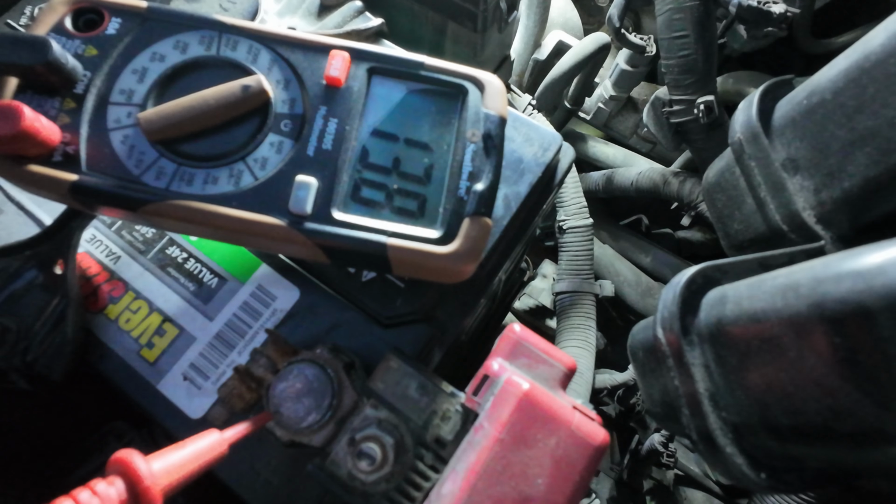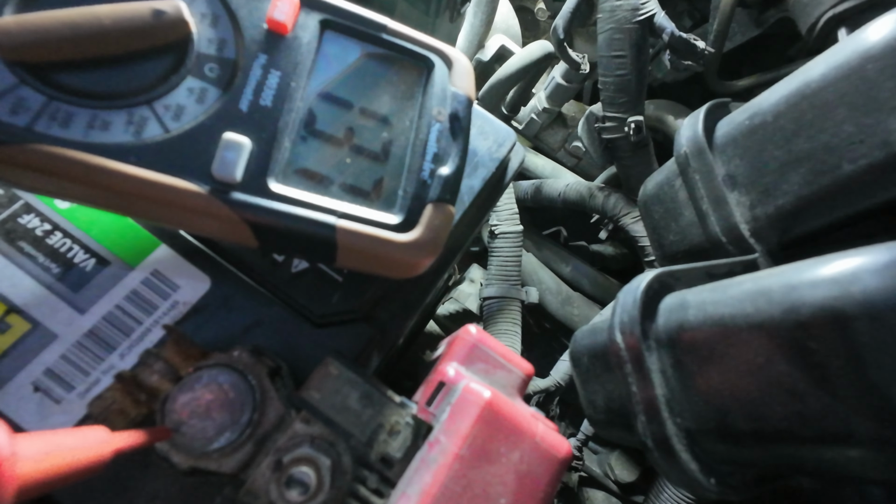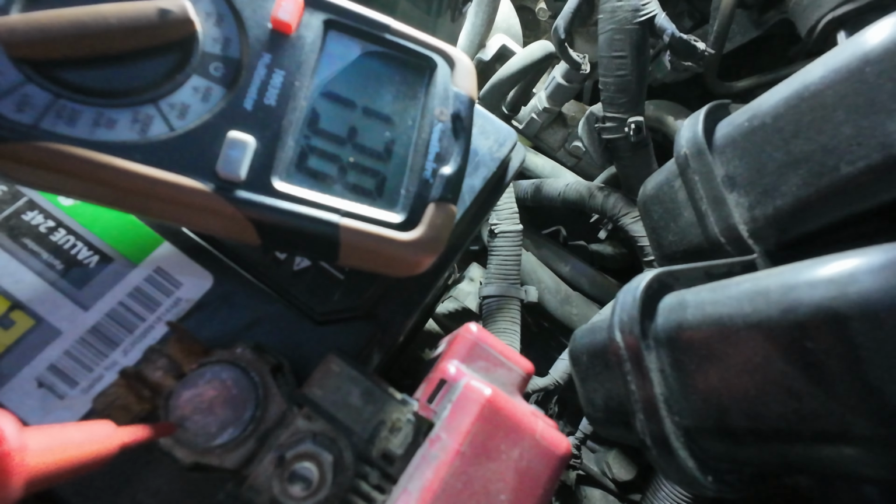13.8. I'm gonna turn the headlights on. Stayed 13.8. When we turn it off, it shoots up to 14 or so. Okay,